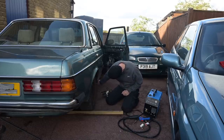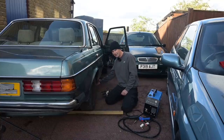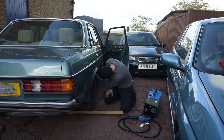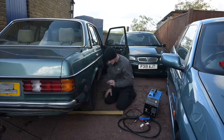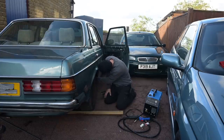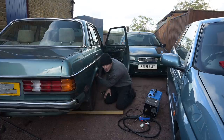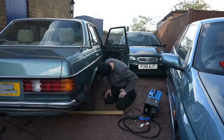This jacking point has gone as badly as the front one had done, so some heavy gauge steel, having cut this back, welded into here to make this solid and again rust-free. Up inside here there is quite a lot of rot which I'm hoping, once I've pulled out all the old bits of what used to be metal, we can just plate in with a nice simple - oh, it's full of mud at the bottom, that doesn't bode well - nice simple repair. The fact I'm pulling this out with my hand is not promising.